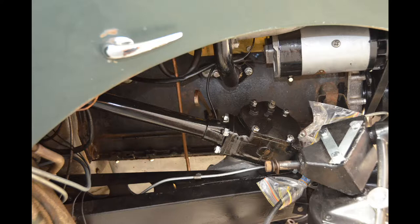As I mentioned in that chapter, I've fitted new oil seals. There's also a little seal right at the back end or bottom of the steering box where that centre tube goes through — like a little rubber seal. I was able to use a Land Rover part, specifically a Series 1 Land Rover part, which has the same part number and fitted perfectly.